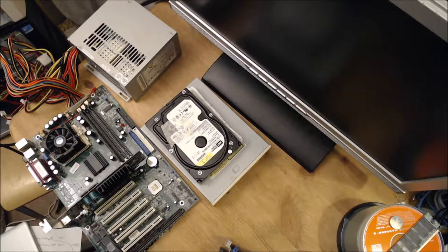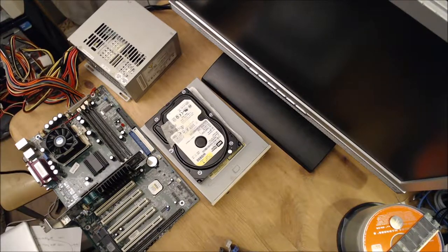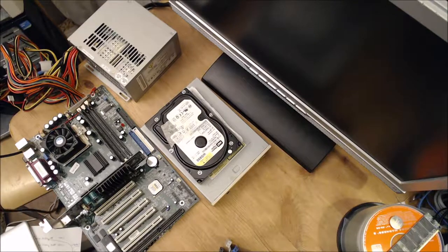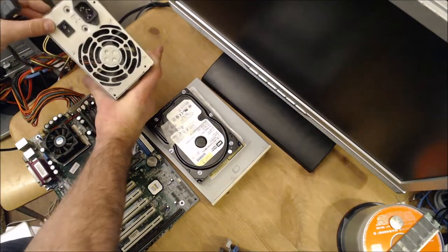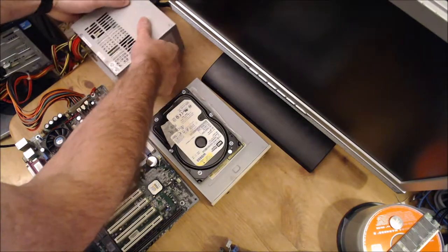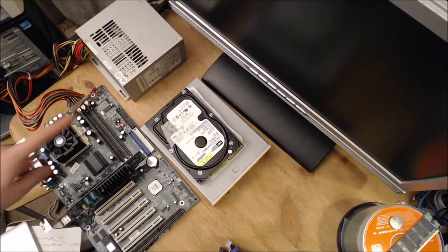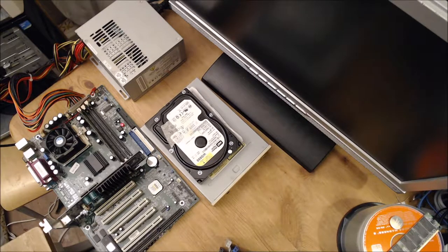At this stage we just want to see if this motherboard and processor posts successfully. And I am hoping, but I could be wrong, I am hoping that the processor configuration is in the BIOS. Nice thing about old power supplies or high quality power supplies is the on-off switch, so you can actually switch it off before connecting it. And then switch it on. Got a red light here. It shows the motherboard's at least partially happy with everything so far. And it's making no strange noises. Nothing of concern, although we should connect up the display.